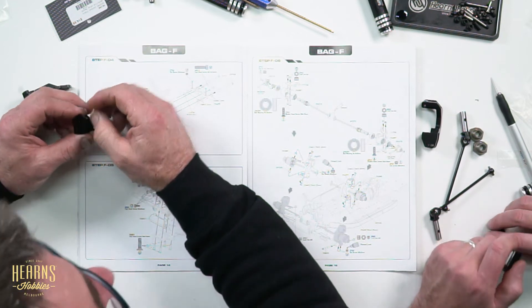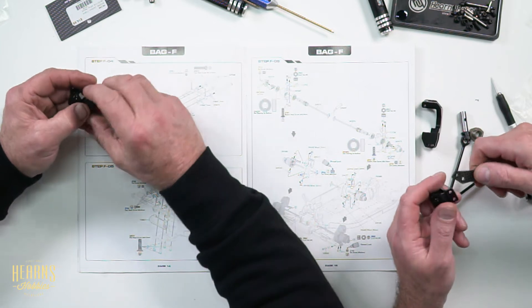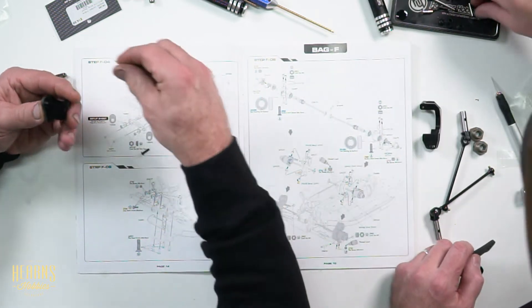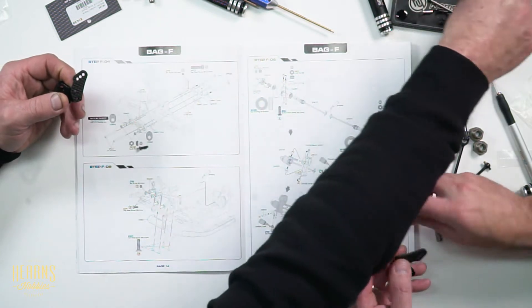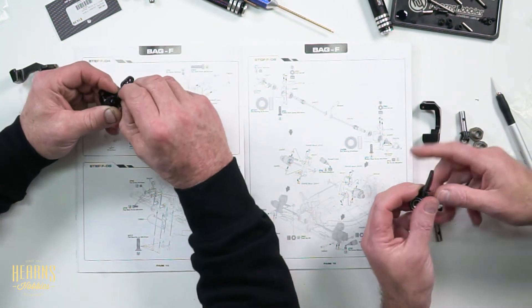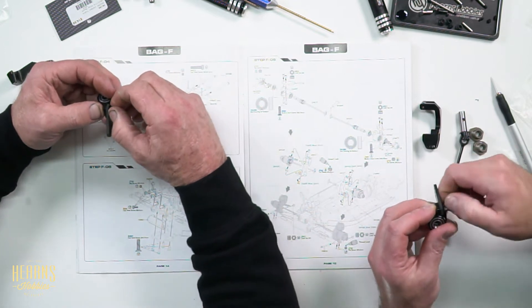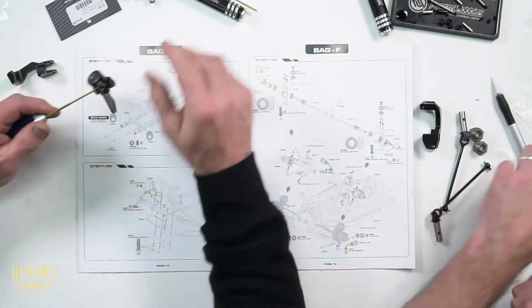So if I'm doing left... you're doing these ones. It's got to go that way - Ackermann plate on top, which means the dots point downwards. So that's pointing down as well. And you need button head screws, metric three by ten. They go all the way through from underneath, and then you get two 5.5 nuts. So what's interesting is they haven't tapped the aluminium - I think that's great because you can't strip the thread in it then. If you damage the thread, it's just the bolt and nut you've got to get rid of.